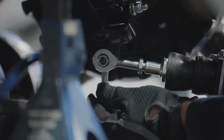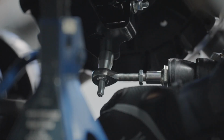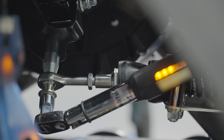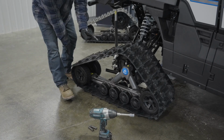Attach the stabilizing rod to the anchor bracket using a wrench and the long spacer bushing, short spacer bushing, flat washer, and nut. Apply the recommended torque. Check the spring assembly bolt and make sure it's tightened to the recommended torque as well. Now install the 2 remaining wheel lug nuts.